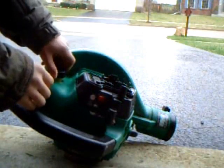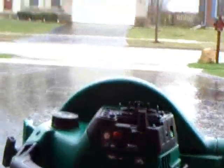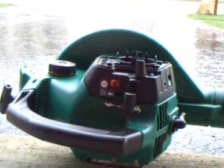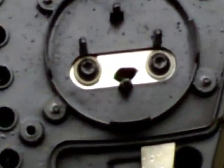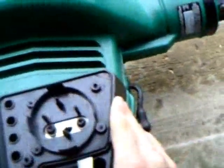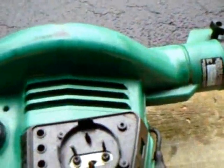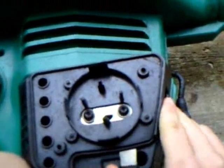I'm just going to try and feed the carburetor. Well, I can't find a bottle, so I guess I'll just take the cap of my gas tank and feed it. What I'm actually doing to get it running — you feed it right into that little hole right in the middle. That's your choke hole. You can see that the size of the hole changes as you move your choke lever. Now we're full open, half closed. We'll leave it full open.